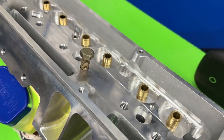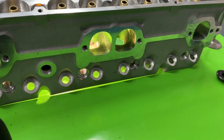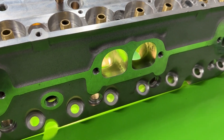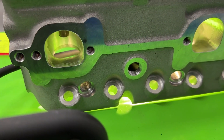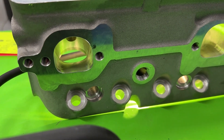Let's talk about the exhaust ports real quick — they are a D-port exhaust. They're nice, they look beautiful. They are raised exhaust ports, same as AFR and all the others mentioned so far. They're all raised, which is really nice. These are actually raised up slightly more than the Trickflow, which also had a D-port, and this D-port from Profiler is actually bigger than the Trickflow as well.